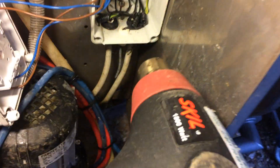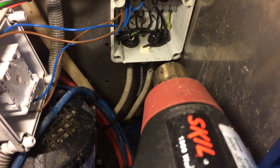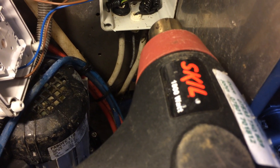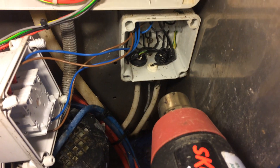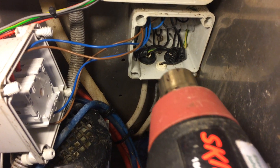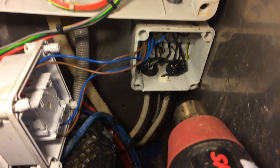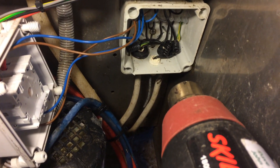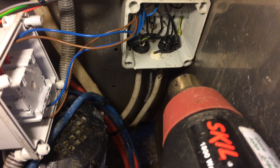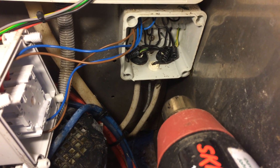I'm going to get the hot air gun. I've got to be careful because we're still live up to that switch. I can't turn that off without turning the compressors off — I'm using them to drive the warm air every moment. So before we start playing with these two boxes we'll turn everything off. If that water's touching it's not earthed because it's a plastic box — it wouldn't trip our fuse or anything, but you'd have a certain feeling if you put your finger in there.